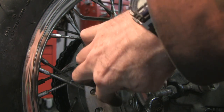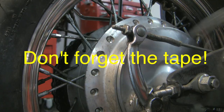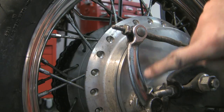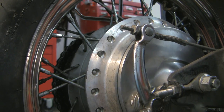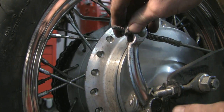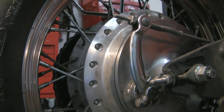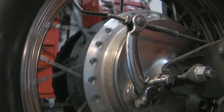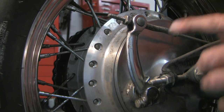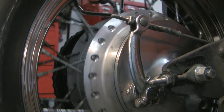Now's a good time to double-check and make sure that crack right there is no more than about a millimeter. I'm going to take off the tape now - it's done what I wanted. In terms of the brake rod angle, you want this angle to be about 80 to 90 degrees for the best mechanical advantage. It looks like it's about 70 now, so I'll just rotate that a little bit. Just as with regular drum brakes, you can adjust the tightness - that's actually pretty good there, and it feels good on the pedal as well. Remember the bike has to be in neutral to do this, but it's also a good opportunity to inspect the chain more carefully.